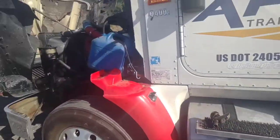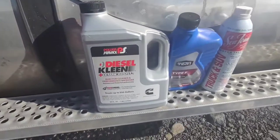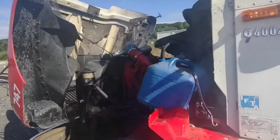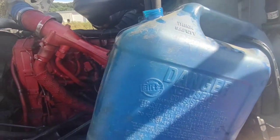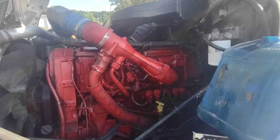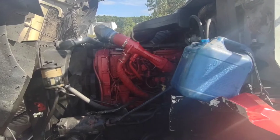What I've got in here is about two gallons of kerosene, two bottles of diesel cleaner, two quarts of ATF, and Seafoam — which works on everything. I know all over the internet it says stuff will break your injectors if you have HPDI or some cheap injectors, but at this point it doesn't really matter to me. It's going to either need new injectors or this is going to clean some of them out. I think it's only one injector hanging up somewhere around 1,500 RPM.